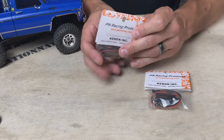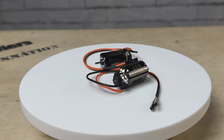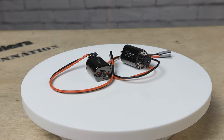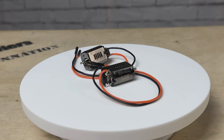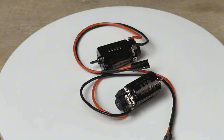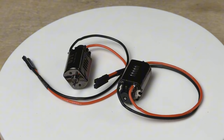Here are our two motors — let's open them up. This is the 63-turn high speed motor, stamped right on this really nice dark stainless case. Very cool looking. And here we have the 90-turn high torque motor. Both are 180 size, a direct replacement for the stock Traxxas 87 180-size Titan motor, but designed to be much smoother and more efficient. They've taken steps to increase cooling ability with a new end bell design and cooling vents on the top and bottom. These have upgradable and replaceable brushes and brush holder, providing smoother action and less choppy driving feel. I also like the two-pronged motor connectors — if you put portal axles on and need to reverse your wires, you can easily do so.